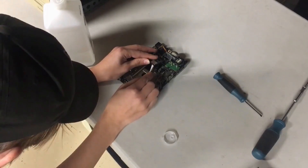Once you've done all these steps and you're still running into issues with the drive reading the disc, there are a few other things to try. At some point, clean the read and write heads — on most of these drives you can use a cleaning disc as they are double-sided, but the easiest way to do a thorough job is to take a Q-tip and some isopropyl alcohol and clean it yourself by hand. Also, if that doesn't fix your issue, check the floppy drive cable as I've run into issues with those causing problems as well.